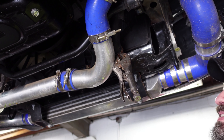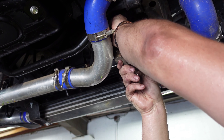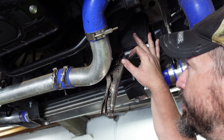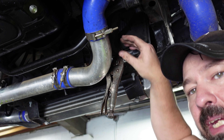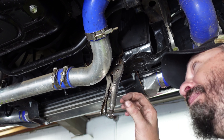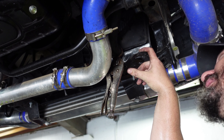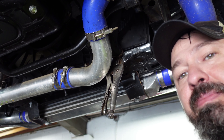I left the vise grips on because it's a squeeze-type clamp. We'll just push the hose back on — it should go right on. The problem is the plastic shroud is sitting too far down, so I need to loosen all the 10mm bolts and shift the plastic up. That'll allow the hose to slide on and let the clamp slide down. I'll loosen them, push it up, snug up the fittings and the drain. This is where the sensor would go but we're running electric fans so we don't need it. Adjusted the shroud and ready for coolant.